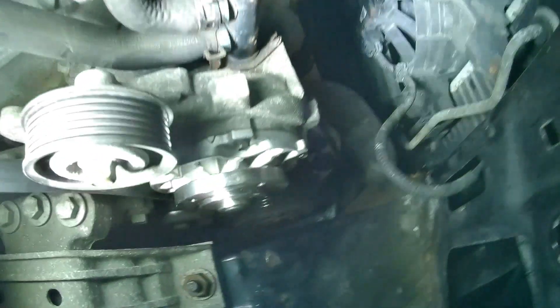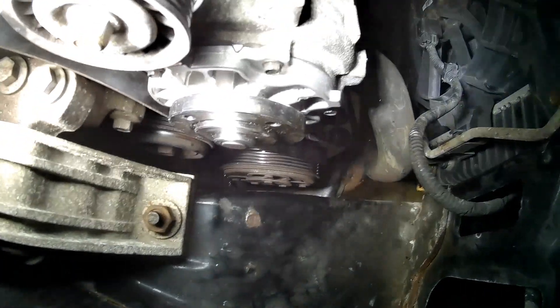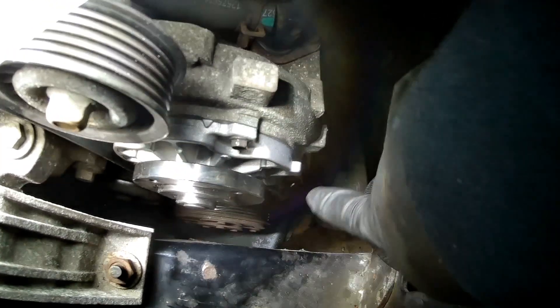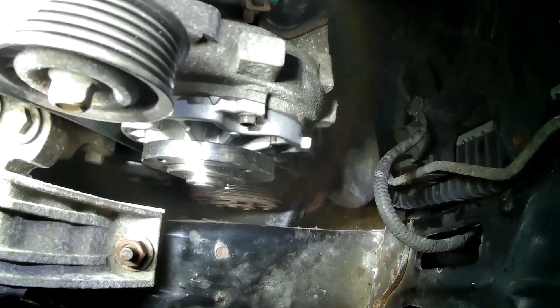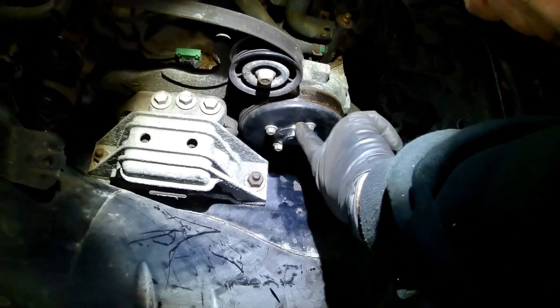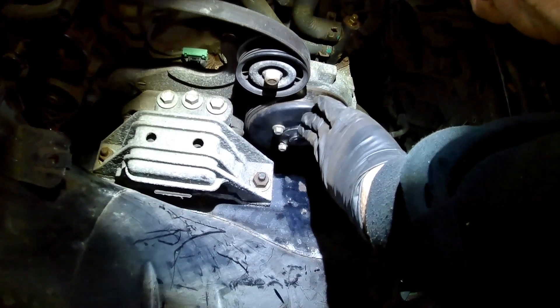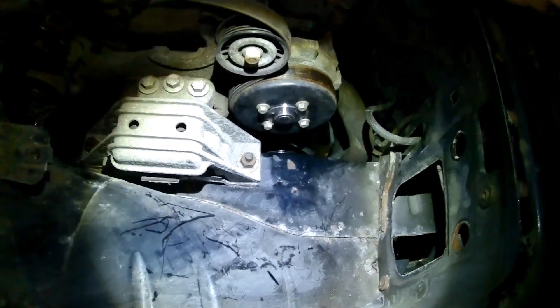While you're tightening the five bolts on the water pump, you want to go in a star pattern to work it in little by little — over here, down there, up here, over here — just work it in little by little to get it tight. Water pump in place, put the pulley on and make sure you try to spin it to confirm it spins freely, because if they sell you the wrong one it will not spin.